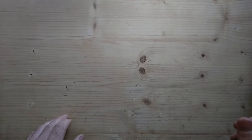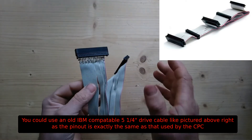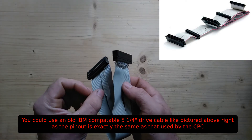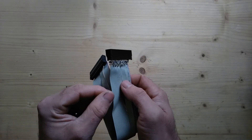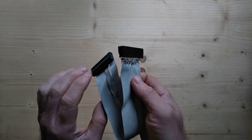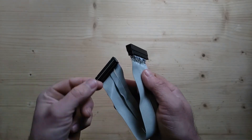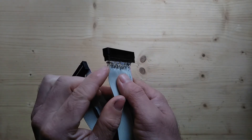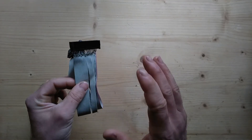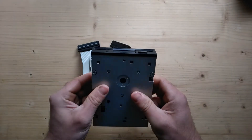Regarding the cable I manufactured: this modification needs to be done whether you buy or make the cable. The three and a half inch disk drive on an IBM PC needs a drive ready signal, provided by shorting pins 33 and 34 on the drive. Since the Amstrad CPC doesn't provide this signal, we need to force it. After making or buying your cable, simply short pins 33 and 34 to enable drive ready and you'll be able to use the drive.